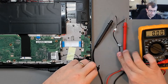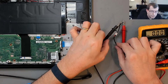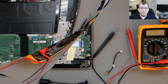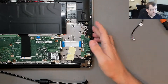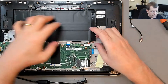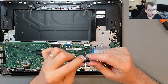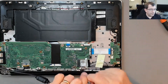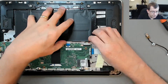It's getting hot — yeah, okay — and it's not shorted there, so safe to say the charging port is bad. I'll see if I can get a new one. New power jack ordered. I'm just going to put this away and wait for the new one to arrive. I'm going to reconnect the battery but leave the power jack out, because it's a bit of a fire hazard — that was shorting out inside here and causing this to get so hot that it melted. I'm going to talk to the owner; she says she has multiple chargers and I want to check to make sure none of the other ones are melted.